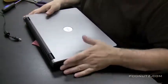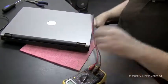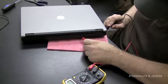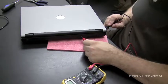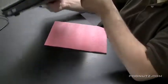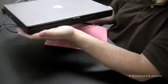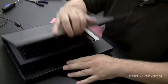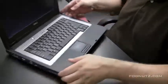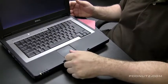Now let's test it. Before plugging the power adapter in, it's a good idea to test for a short circuit — I'm attaching the red probe to the center pin of the power jack and the black to a ground point on the other side. If my meter beeps, that indicates a short circuit and I'd have to take it apart again. No beep, so we're good. I plug the power adapter in and you can see the light comes on at the bottom left corner of the screen — it powers on with no battery. That's how you do a power jack repair on a Dell B130 laptop.